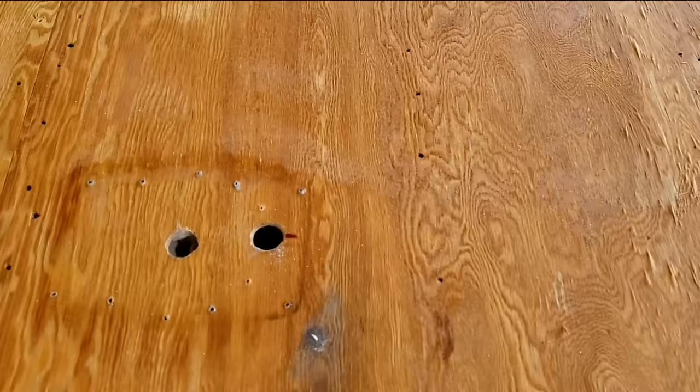When I'm putting this roof radius on, I'm not going to do what the factory did and pull this thing tremendously tight. I will pull somewhat just to make it taut, kind of keep any bubbles down. In the corner, we're still going to put this gutter extension on there. But this little area is very susceptible to water coming in. Now because it's wrapped over and sealed behind this molding it is fairly tight. But once I put this cap on, it's going to be very difficult to get a bead of sealant in there. So if we put all the sealant in right now, it'll ooze out and fill all the gaps and we won't have that issue. This guy is going to slide in behind here and get screwed down, so I'll fill this entire gap and everywhere behind with some butyl sealant — it should ooze out pretty well.